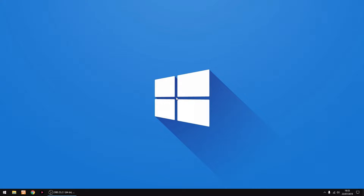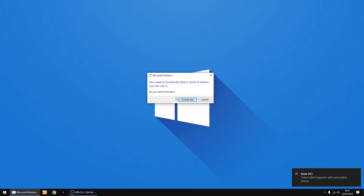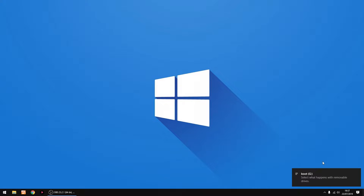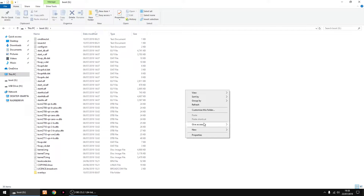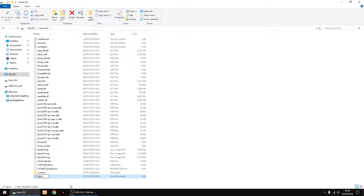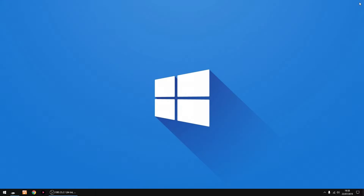The thing you wanna do now is unplug the SD card from your PC, and then you wanna plug it back in again because we need to add a little file to the SD card. Go into File Explorer, into the SD card, and the thing you wanna do is add a text document and put SSH. Remove the .txt extension, and then yes. So all you want in there is SSH.